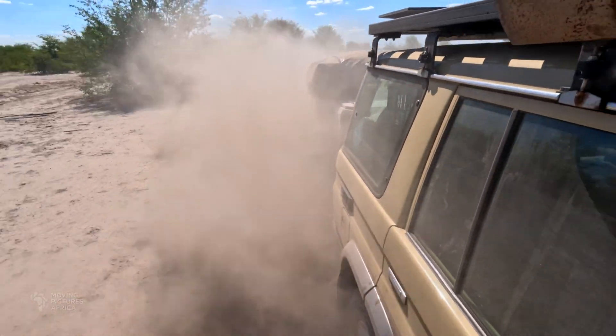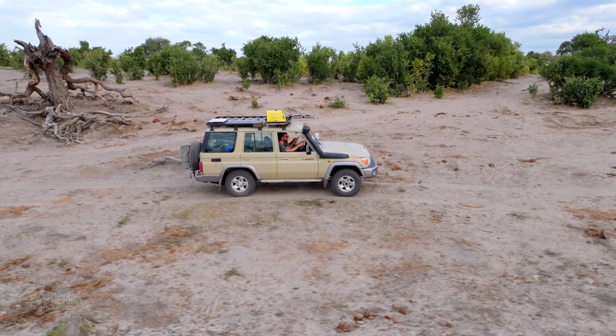In the work I do, my equipment is subject to a lot of heat, dust and bumps. I've just got the EcoFlow so I can't really speak about its reliability. My Victron dual battery systems have been absolutely bulletproof over the years. I think if you buy good quality components, your most likely point of failure is in the installation — maybe undersized cables or a connection coming loose on rough roads.